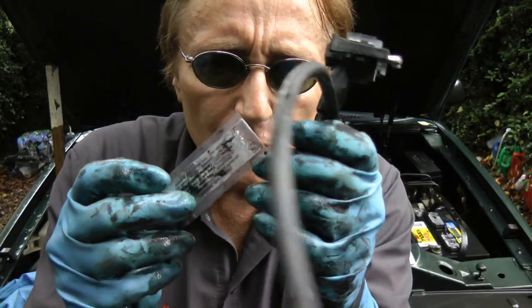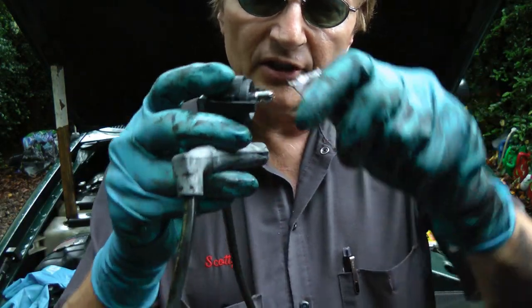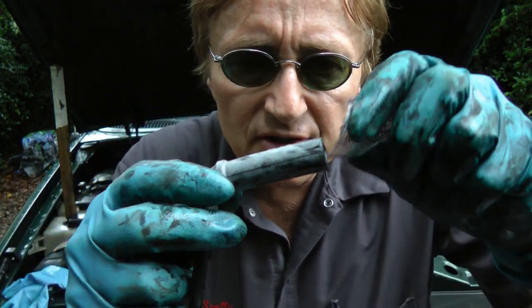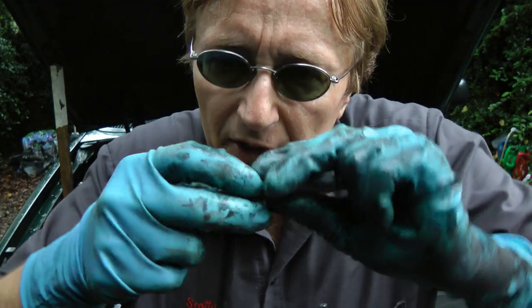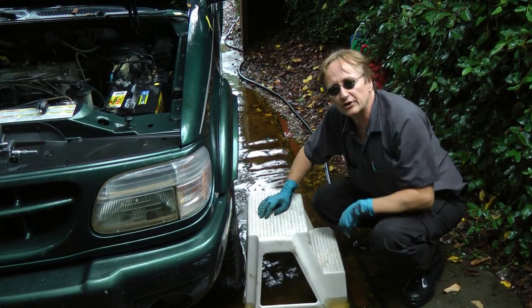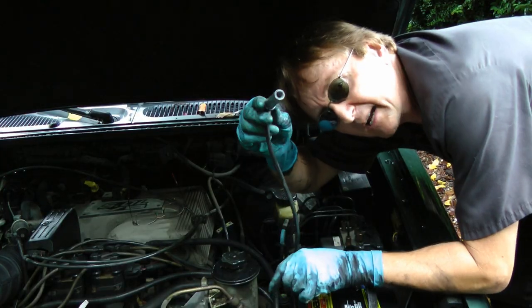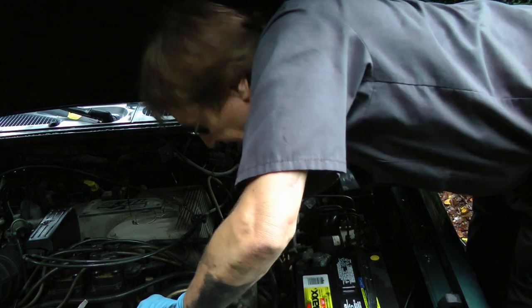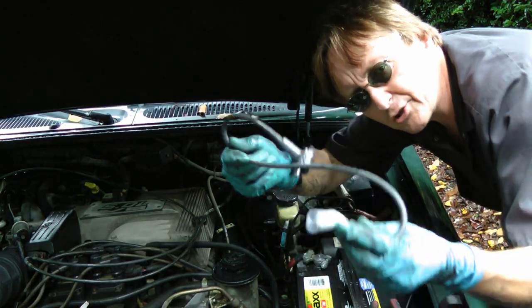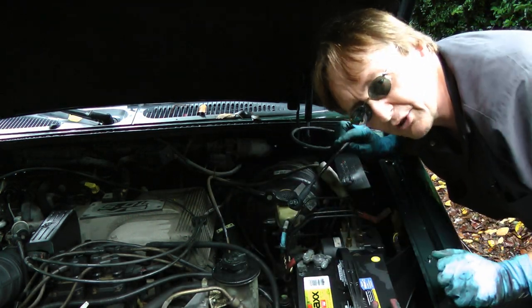If you notice when you buy good new spark plug wires, they come with a little package of silicone grease. You put a little bit of that grease on the end where it plugs into the ignition coil, and also a little bit inside the spark plug boot where it goes on the spark plug, so the metal gets good contact. Since there's not much working room on these trucks and they're high, I get a little step and climb up so I can push the wires in better and not hurt myself squeezing too much. Be sure to do all of the spark plugs and wires, because if one is worn and cracked, the rest are soon to follow.